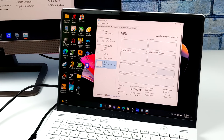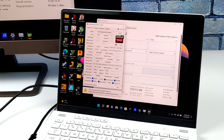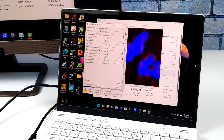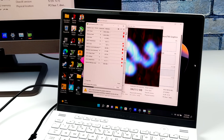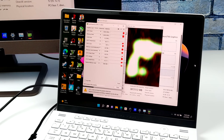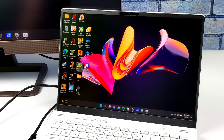What I have here is the Asus G14. It does have a dedicated GPU, but it's totally disabled — I personally haven't even tested it. This was the only laptop I could get my hands on with this new APU, and it happens to be the 6900HS. Along with that, we get 16 gigabytes of DDR5 running at 4800MHz, and the all-new AMD Radeon 680M iGPU, which is based on RDNA 2. It has 12 CUs and a clock up to 2400MHz. For integrated graphics, these are the most powerful on the market right now — a massive jump forward from the old Vega iGPUs, beating even the highest-end desktop variant. And we're working with a mobile chip.